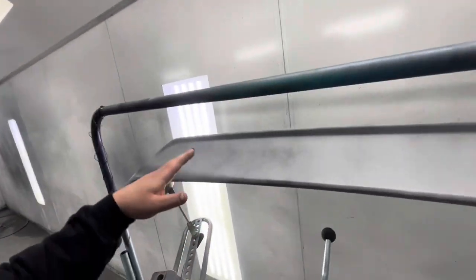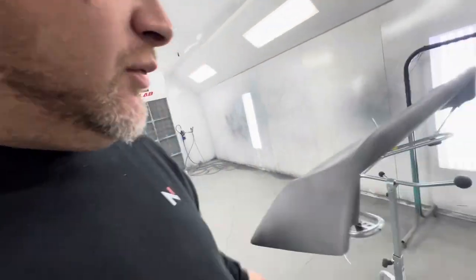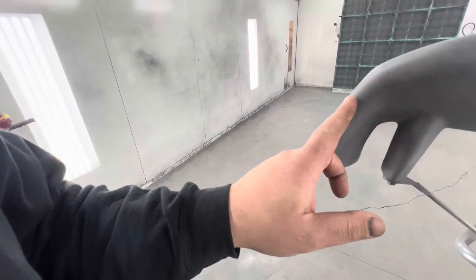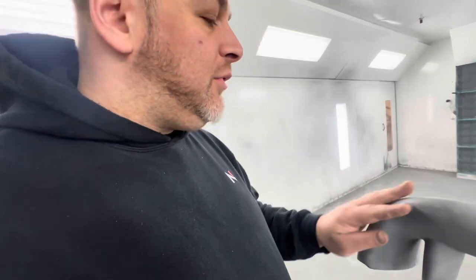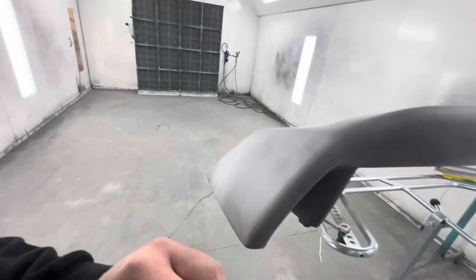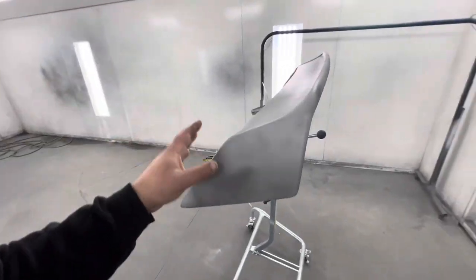You can see here we got Tail's R32 Nissan Skyline GTR-style spoiler. He went ahead and prepped it out and I went ahead and shot some primer on it yesterday when I was priming the bumper. There still needs to be some work done on this for sure. I noticed when I was wiping it down, I did see some small fractures in this area right here and a small crack right here. You really can't even see them to the naked eye, but I do not want them to come back and haunt us. So we are going to shave out this corner with a grinder, throw some new fiberglass-reinforced filler on this corner, block it out, fill some pinholes — fiberglass parts always are full of pinholes — sand this thing out, inspect it really thoroughly, and apply a few more coats of high-build primer to get this thing paint ready.